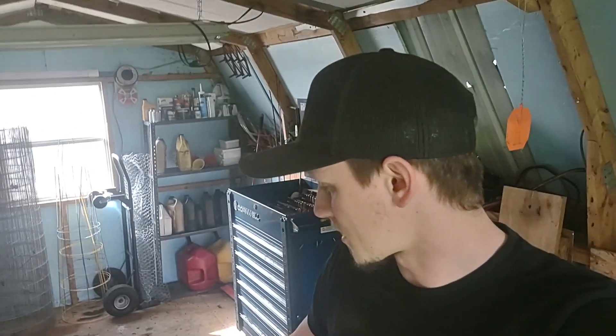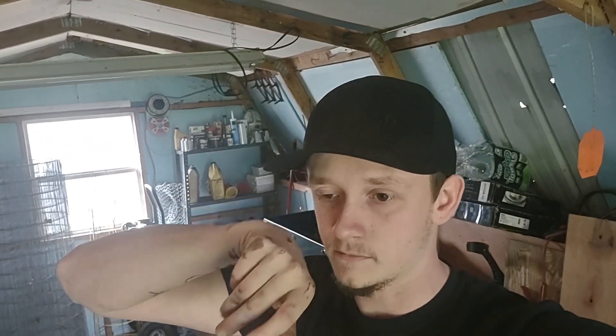What's going to happen is that crack is going to further its travel — whether it gets onto the bolt or goes all the way around the main web — and your crank is eventually going to get destroyed. So why do main web cracks occur? There are a few contributing factors; it's not based off just one thing.